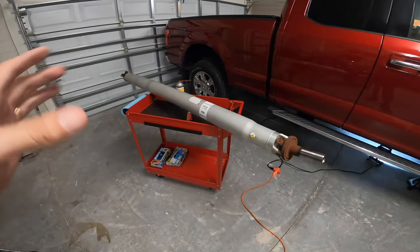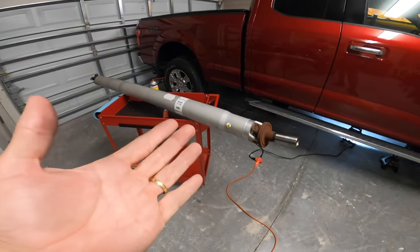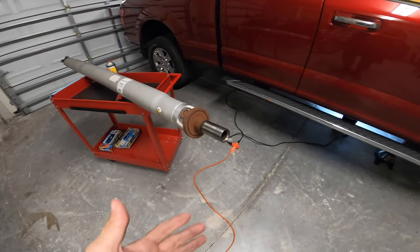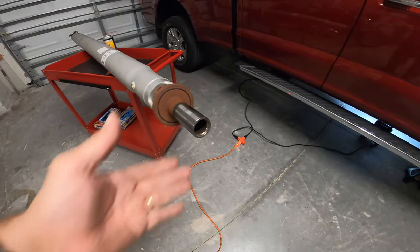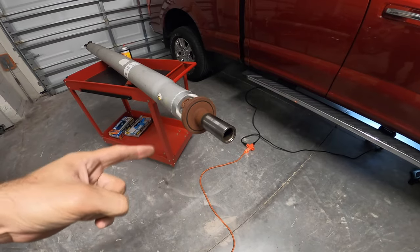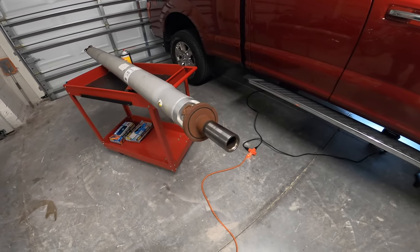It's nothing bad. From what I've researched it's something relatively common with F-150s, but it's still annoying. I found out it's probably due to lack of lubrication inside the spline — and as you can see there's basically no grease, it's bone dry. So we're gonna lube this up and put it back in, and I'm gonna show you guys the whole process so stay with me.